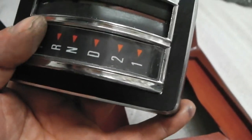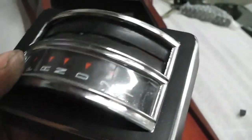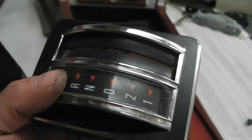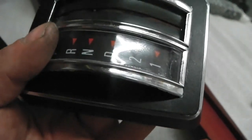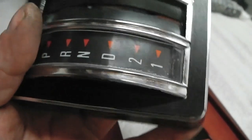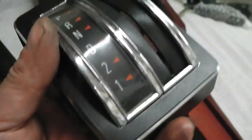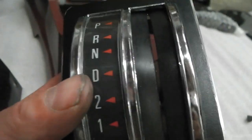And then I used a heat gun to curve the plastic to follow the profile of this. I curved it round a Hammerite tin. Got it hot, then let it melt over the Hammerite tin. Watch out, the Hammerite paint finish on the tin can melt and mix your plastic up, so use a piece of paper over it, which I did in the end.